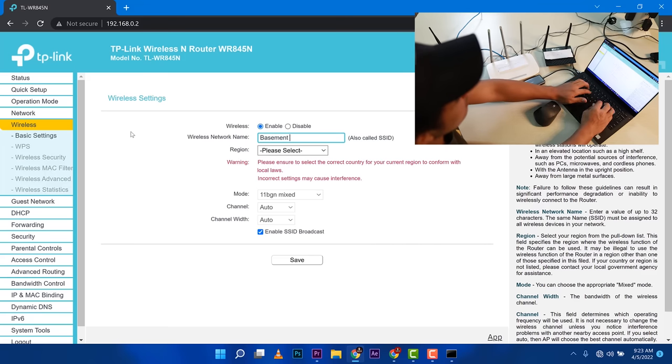This is already connected and I'm on Wi-Fi — plugged into the yellow port. Do not plug it into the blue WAN or internet port, because this will act as an access point. I can access the ISP router at 192.168.0.1 and the basement router at 192.168.0.2 — both accessible from my Wi-Fi, meaning we are on one network.